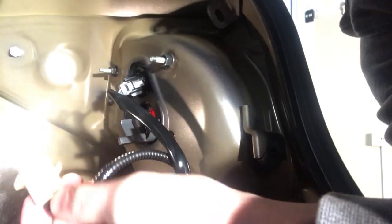What you see here is your brake light and your turn signals. The one on the very top will be your turn signal. All you're going to do is twist and pull — there's your turn signal. I'll put a link below in the description for all the bulb numbers, where to buy them, and what I recommend changing them out to. And this right here would be a brake light — again, just an easy twist.